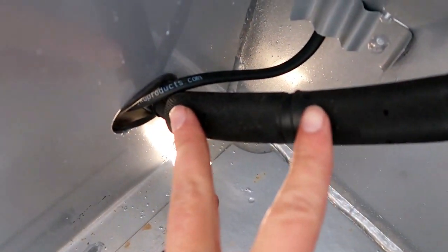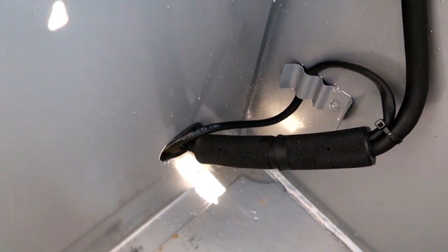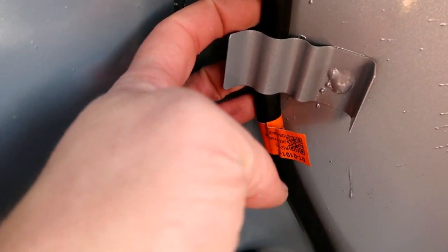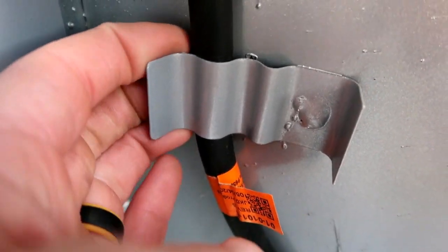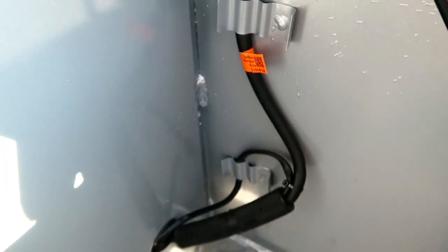Here's a look at that wiring harness. All throughout the trailer they've got these junction points where it looks like they just plug into each other, allowing them to build the whole trailer and then put the wiring in. They powder coat the whole trailer, then these little tabs pop up and stick behind there. That brings us to one of our flaws — when they pull up these tabs, the powder coating on the backside usually breaks. So you do have a place that could potentially have rust back in there. It's inevitable, I think.